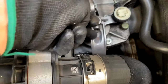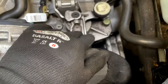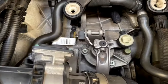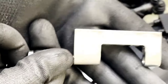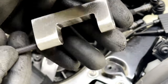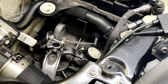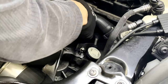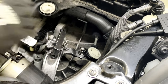We're going to be replacing this piece of metal here with the short shifter, which is going to be extremely lighter, which is quite good. I'm going to put it into reverse gear so we get the best positioning with everything, making the job a lot easier. Now we have to release the pin inside this bracket here — Forge supplies the tool to do that — and it's just going to push the pin straight through and then just pop out the other side. We put the tool over the bracket and start feeding it through, making sure it's aligned, then get a spanner.